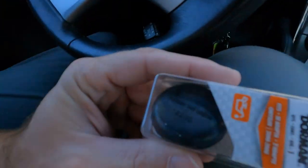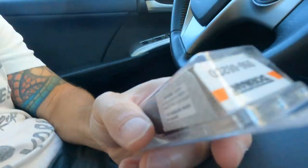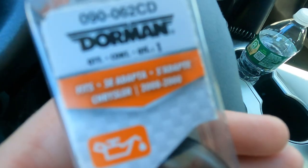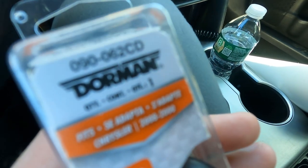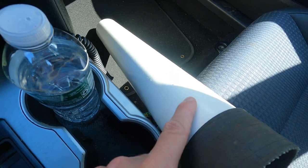Just left Advanced Auto. This is about the only plug I found — hopefully that works to plug the prior location of the air intake temp sensor. The new sensor is going to get drilled into the pipe here, and this is going to be our new mass airflow-free intake. Let me run home and start getting this knocked out.